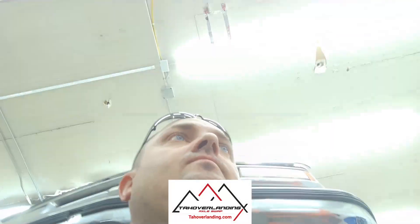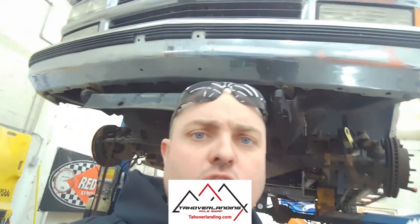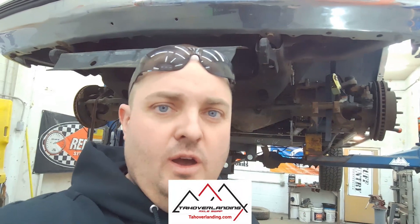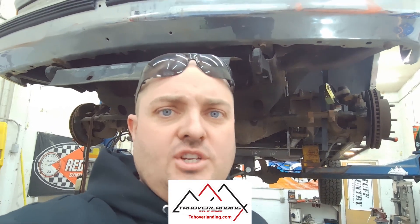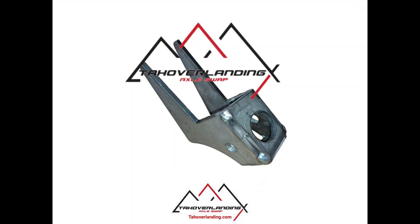It takes a little bit of your time to make sure every little thing is in the right position to maximize the performance of this swap. It's also worth noting these wings here — they're larger than most wings on aftermarket track bar brackets on the market. You may need to trim some off depending on where you put these, how far forward or back you end up placing this. That said, 99.9% of customers do not need to trim at all.